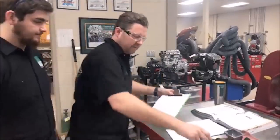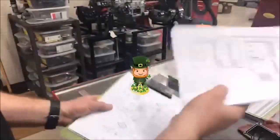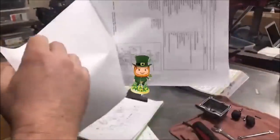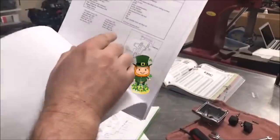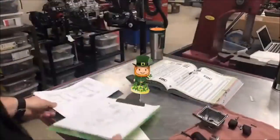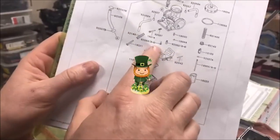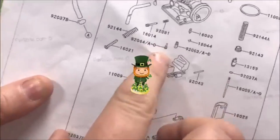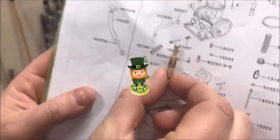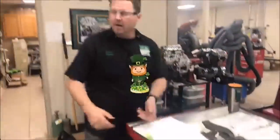Then I went to the parts fiche, because I started using resources. Before the parts fiche, I have the pages on the manual to see what size jet should it be. Here's the actual service manual. Even looked aftermarket to see what the recommendations were. Doing all this research, I went back to the good old microfiche, and this is where I got into a little concern. This jet right here is the pilot jet — look at how it doesn't look to be the correct one. As soon as I saw that, I went — yep, no, my problem. That's it.